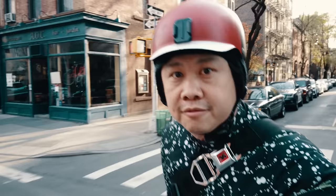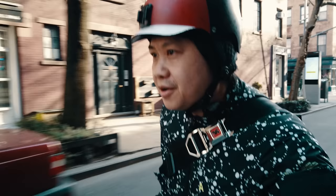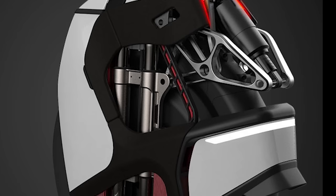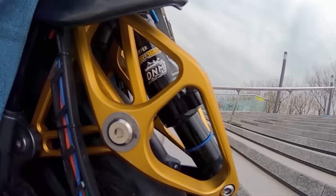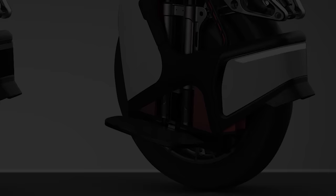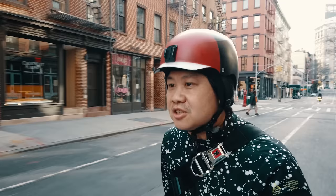For a company that strictly limits the top speed of their wheel to 31 miles per hour for safety reasons, King Song took a radical approach to this problem. In their design, the only components on the unsprung side are the wheel and the hub motor, which partly explains the open casing design on the S18. You can see how the shock practically pops out of the casing towards the end of its travel. Since you have components moving against each other, it is no longer possible to have a single sealed enclosure — instead you have to seal the individual components. The batteries are inside those red rectangular aluminum boxes, which means more potential points of failure.